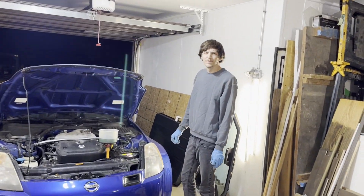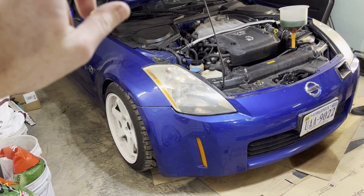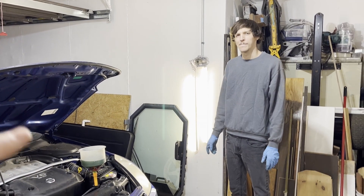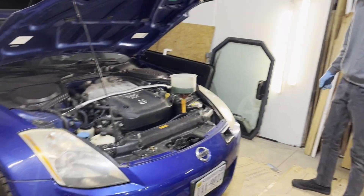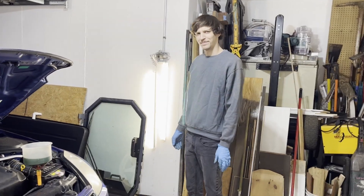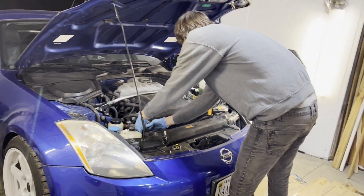We're going to align Nick's car before Sunday — he has another drift event. Since the last drift event he got new front tires, upper control arms for more camber, and he also cut his steering bump stops for more steering angle. He put a big spacer on the front for drift stance and clearance. So this time around should be just that much better and he can keep dialing it in each time. I'm going to get the DSLR out with the zoom lens so I should get some better clips this time, as long as I can get a good spot to stand.